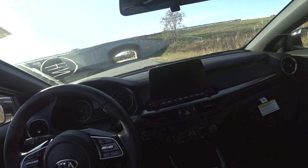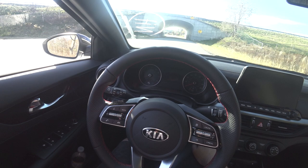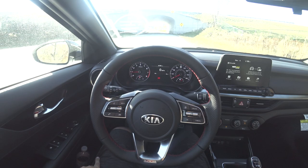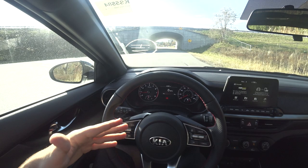Starting the car is relatively simple. Put it in neutral, put your foot all the way down on the clutch, foot on the brake, and push the start button. Once it's started and you're in neutral, you can get your foot off the clutch and just sit here idling.